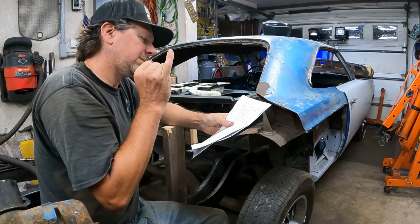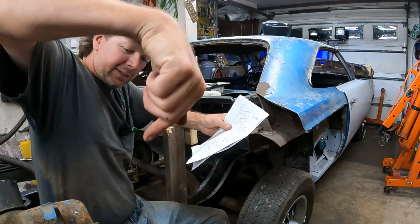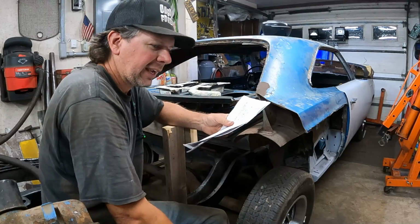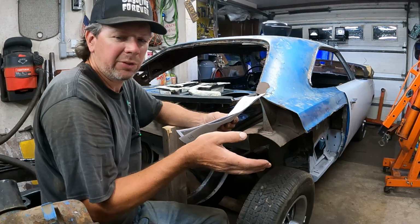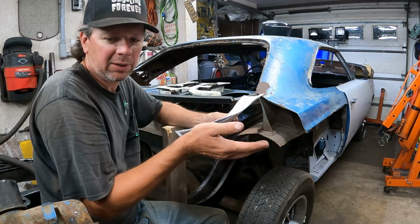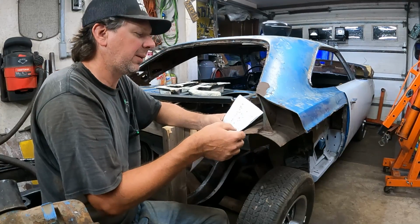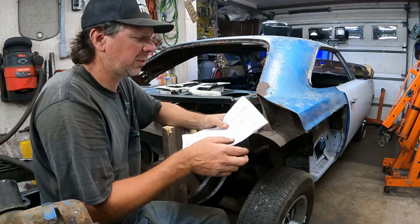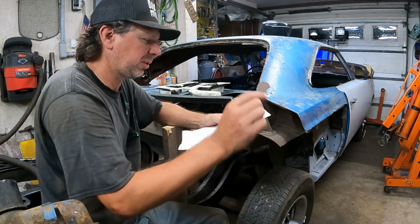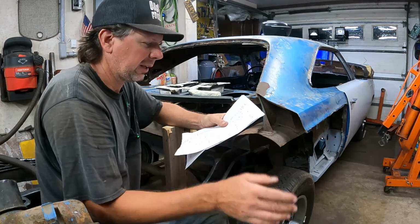Now, we're at $17,500. The 440 that's right here, you're hanging on, I figured to get that rebuilt is like a stock rebuild with a cam. Now, granted, a roller hydraulic camshaft for this, like a Crane cam and lifter set, is close to $1,000. So just keep that in mind. So I'm going to say, 30 thousandths overbore, pistons, like they'll do 9-to-1 pistons for it, popped up a little bit in the hole. 3-angle valve job, rebuild the heads, gaskets, bearings, blah, blah, blah.